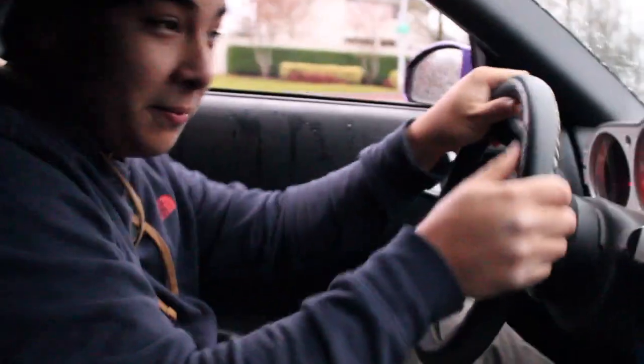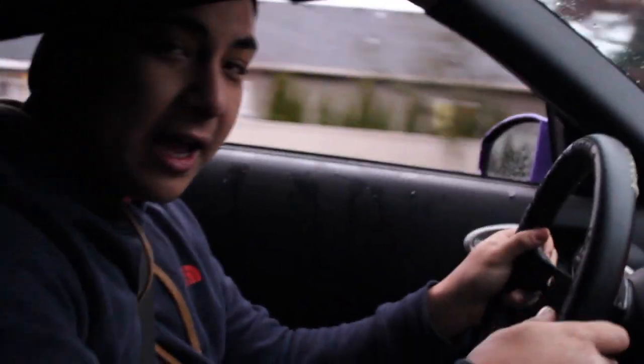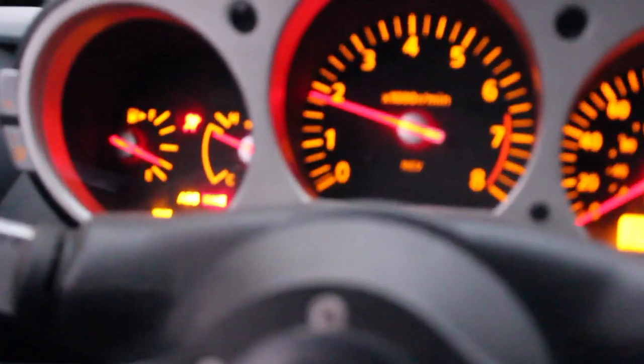We made it one minute down the road and my car's already overheating. I think I have a coolant leak or a blown head gasket. She's overheating - I tried to bleed her as much as possible but I've come to the conclusion that the thermostat is stuck closed.